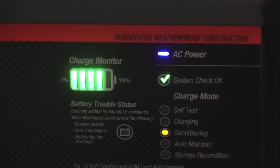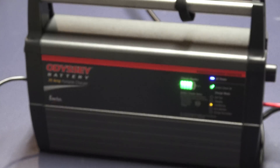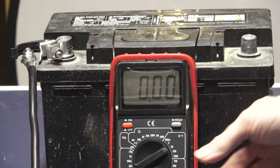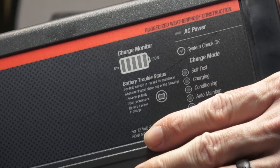Here's something interesting — it's showing not quite a full charge; I don't have five green LEDs, but I'm already in the conditioning stage. I wonder if that's indicative of the fact that it can't get to a full charge. I don't expect miracles from a battery charger, but I did want to go through this exercise to show how it works. Checking the voltage — it gets up to about 11.5 volts and then just steadily drops — dropping like a brick. So I replaced this battery for a reason, and this just confirms it. But at least it gives you a sense of how this charger works. I do expect it to help me keep my healthy batteries healthy. That's it — thanks for watching!